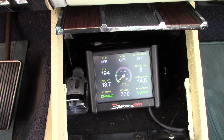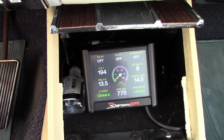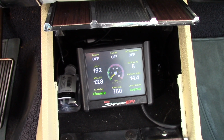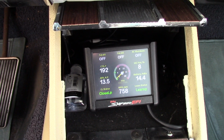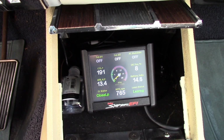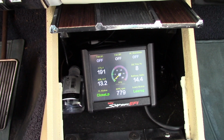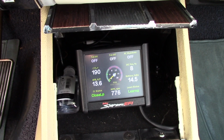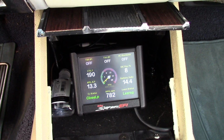And then I have it set to turn off at 195. Now there's still coolant that it was cooling, so that's still cycling to the back of the head now. Look at it, it's dropping, even with the fan off. I'd like to compare this back to my other video that I did when I just had the fan, but I know it wasn't that fast. It took like a minute for it to do that with the fan full on. So I'd say we got better capacity here.